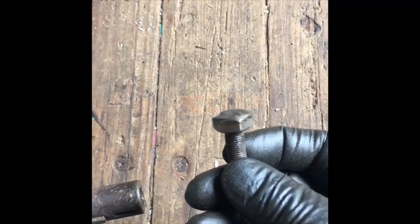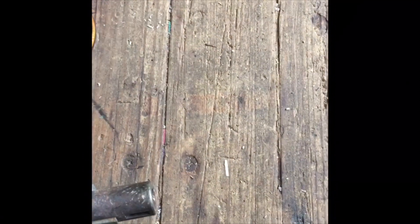I've shortened that bolt and turned it down a little bit on my little lathe — a lathe is handy but not necessary for this job. Then it's welded on top like that with an old socket, the whole bore through it. As you can see, you can see all the way through it, and in goes the driveshaft onto the crankshaft. Then you have this, shortened and ticked off with the measuring so that it meets up correctly below the mating plate. This then slots in here and you have your drive. Very simple and very neat and very effective.